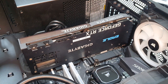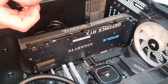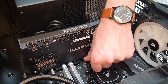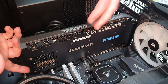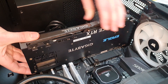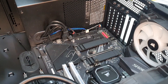These are generally thumb screws so you can get them out with your thumb after you've loosened them. The next thing we need to do — there's a little latch down here, you kind of need to get your finger in there. It's best to do it with your finger rather than a tool. Push down the latch, the card will slightly lift up, and then with a little wiggle it comes right out.